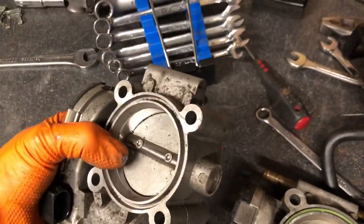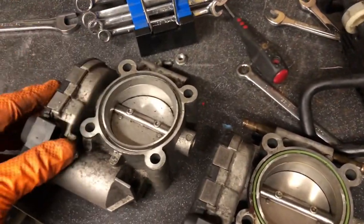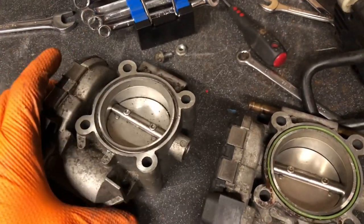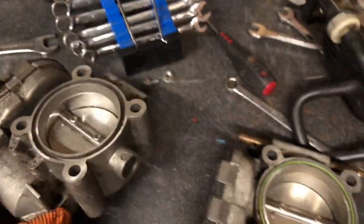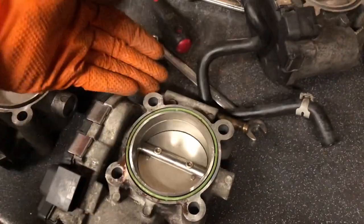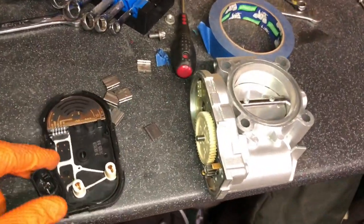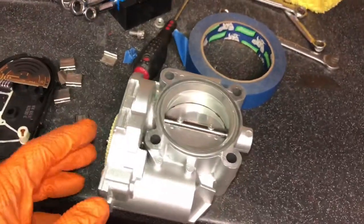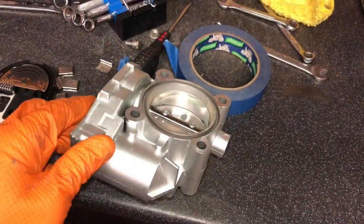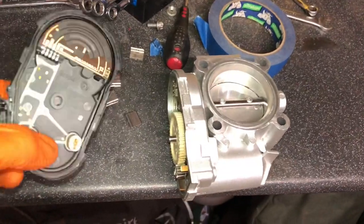On the Z20 LED they have the water cooling, on the Z20 LEH they don't. So whenever you're doing power upgrades on these cars and you've got bigger intercoolers, switch over to the Z20 LEH throttle body - it's the proper way to do it. It's blanked off in the castings. I just took the throttle body apart, took the covering out, greased up all the gears for nice fresh actuation, and cleaned up the housing as well.